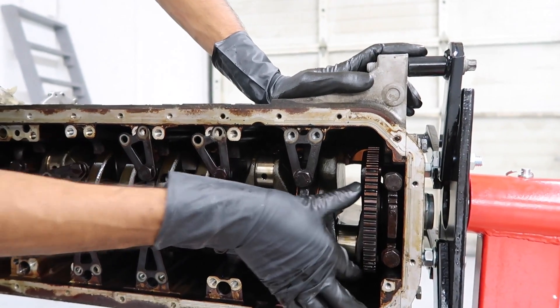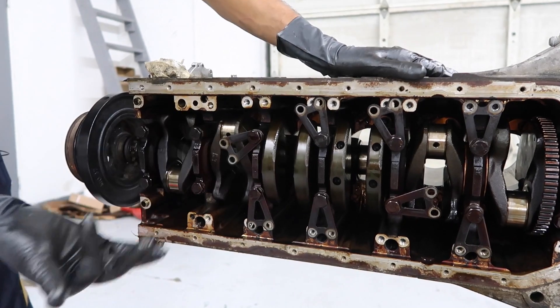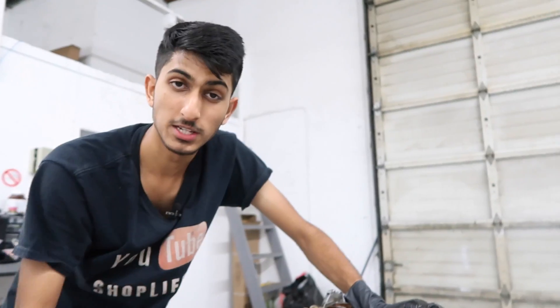Once you get those off, you only have these two 17s left, and once those are out you pull off all the caps and the crankshaft just literally slides out. That's pretty much it for the rest of the whole engine disassembly — all you'd have left is the block, which you can get cleaned and machined. If it has any stripped threads you can helicoil them, and I'll be going through all that once I get the rest of this off. That will be another series on rebuilding the engine, depending on the condition of the head. I'll make a whole separate video going over the condition of all the components. Thank you guys for watching — if you have any questions feel free to leave a comment. If any of you are in Southern California, my shop is in Alhambra — Alpha Motorworks. Message me on Instagram or comment here. Stay tuned and thanks for watching.